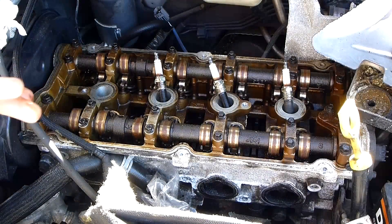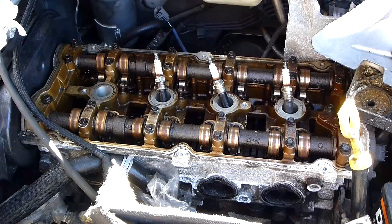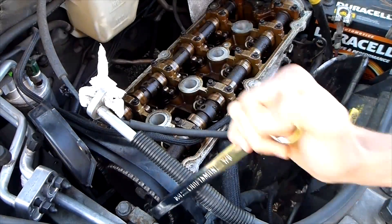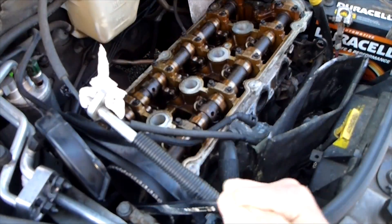You can see the carbon deposits on the cylinder — this is typical. There's not an oil leak, there's no head gasket leak. This would be considered a relatively clean engine. I just wanted to show you that so you have a comparison. Now we're back at the PT Cruiser, and we're going to have to turn the engine to get the number 2 piston down. With the number 2 piston at the bottom of its stroke, we'll go in.